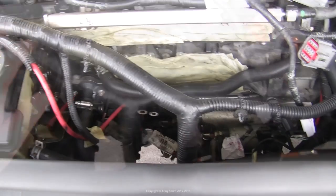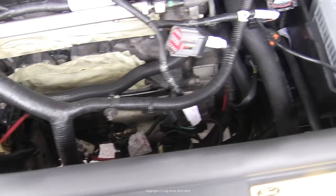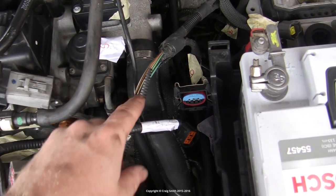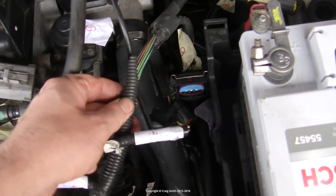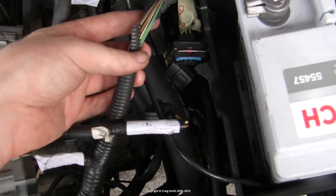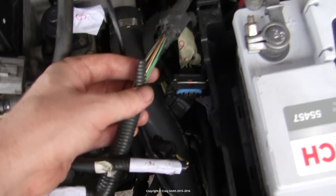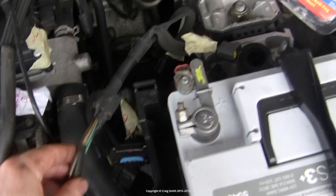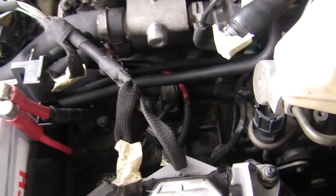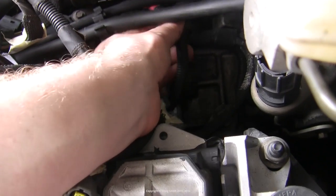You can see here how some of these wires are exposed. This red one is the starter to alternator cable, and over here is the engine management wiring loom where you can see all the little wires visible. So this isn't great, as obviously these wires are now exposed and vulnerable to damage or wear. And over here this red cable is the battery cable, also the one that goes to the starter.